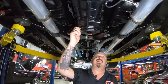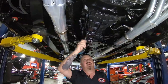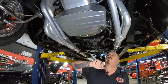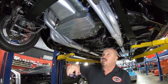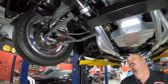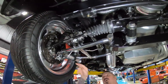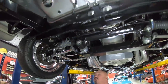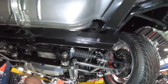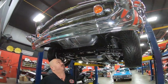It's got a T56 trans here, so you don't have to worry about that 4.30 gear back there. You get out of the hole real good, then you get this baby in high gear and away you go. We got a hydraulic clutch here with a hydraulic throwout bearing. It's got an explosion-proof bell housing, jet-coated oil pan. Up front, all the steering gear is all polished up looking good. We've got Wilwood brakes up front and QA1 shocks and springs holding up the front, and a big NASCAR-style sway bar up front with some more of that custom framework. This frame is amazing.